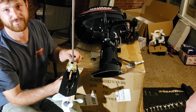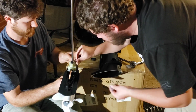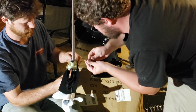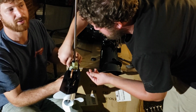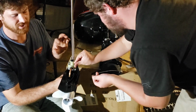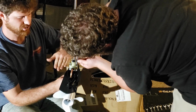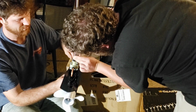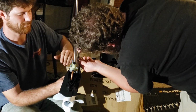The short one goes in the front. And you never want to pull the pieces together with the bolts. If it's not spring loaded, you want to make sure that it goes flush with the piece it's going on to. If it has a gap, take it off, find out what's stopping it, and retry.